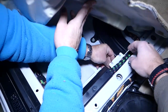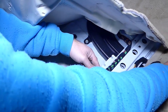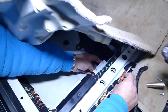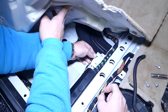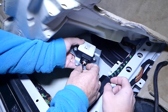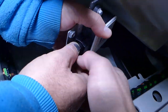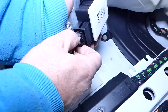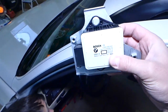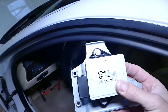You'll be able to slide it out — there is one more bracket holding it, so three bolts total. That whole bracket slides out at an angle. Now you need to disconnect it: press in right here and pull out. And this is your Bosch DSC traction control sensor out of the car. That's how you remove it — installation is in reverse order.